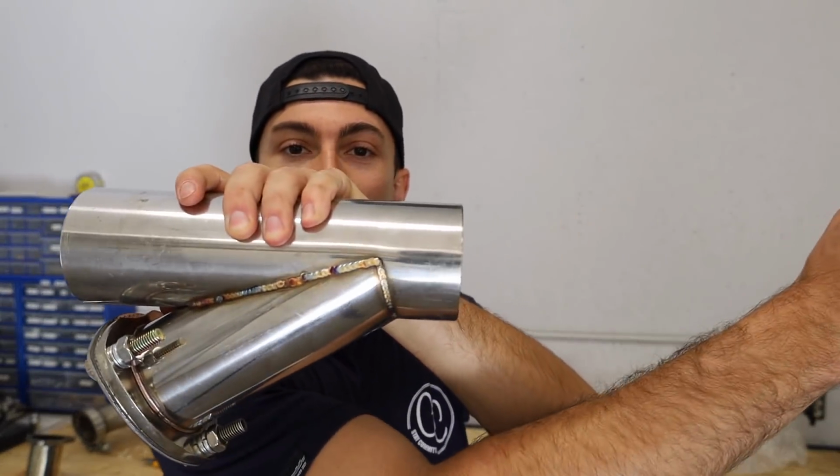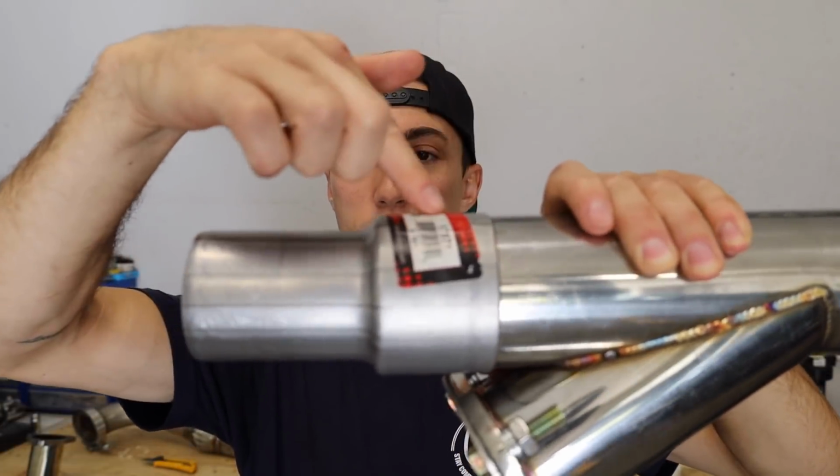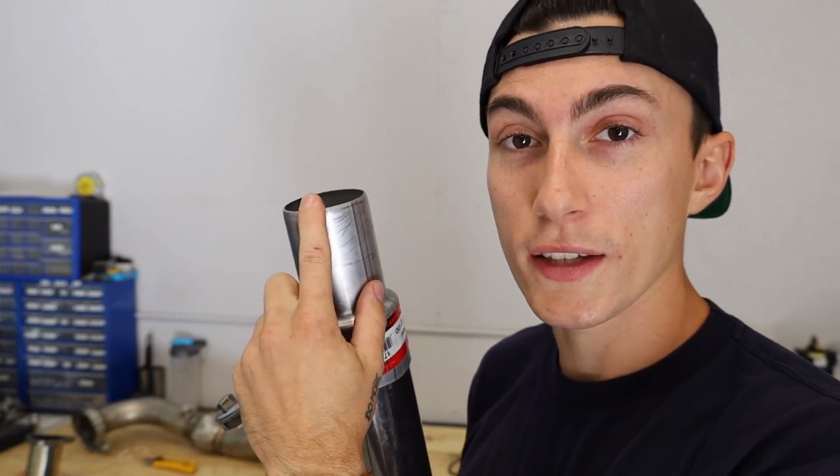And pretty much our plan for today is to go right here. We're gonna go down pipe into here. This is gonna go 3 inch to 2.5 inch, and then this will plug straight into the old exhaust. So when the valve is closed, we'll be running it extremely silently through the stock exhaust system. And when we want to make the extra power, when we're on the dyno, if it's gonna help me get 30 more horsepower from a better flow rate, I can open this boy up, have it be loud as heck, win some races, close it up, and go home quietly.